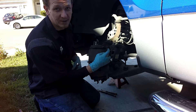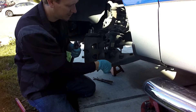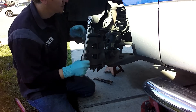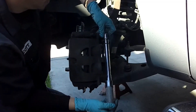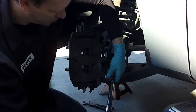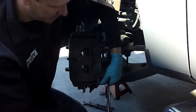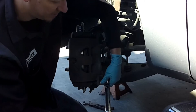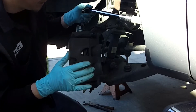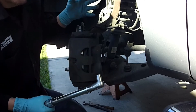These ones are torqued down to 24 to 27 foot-pounds. I set the torque wrench to 24 pounds because these are a smaller bolt with a very fine thread. When they're properly torqued down, you have a better chance of everything flowing better — it's not over-tightened, so nothing's going to be crooked. Make sure you torque everything down; that is something I have to stress.